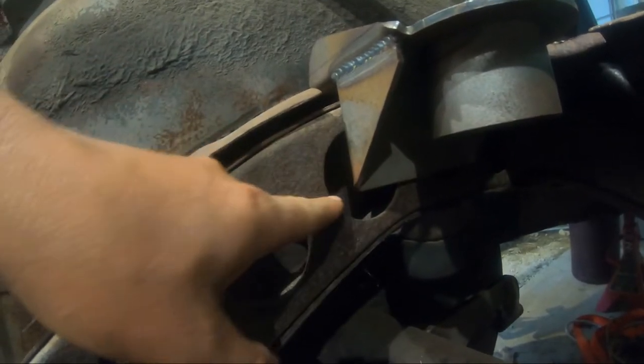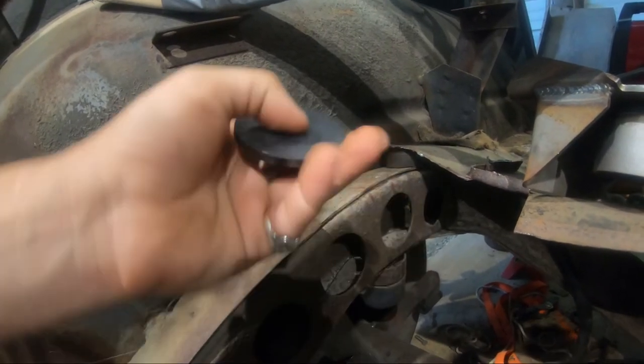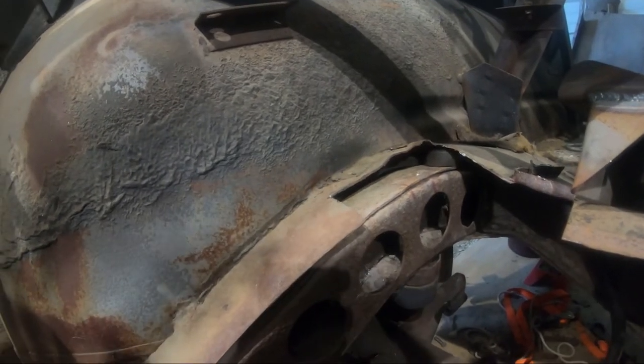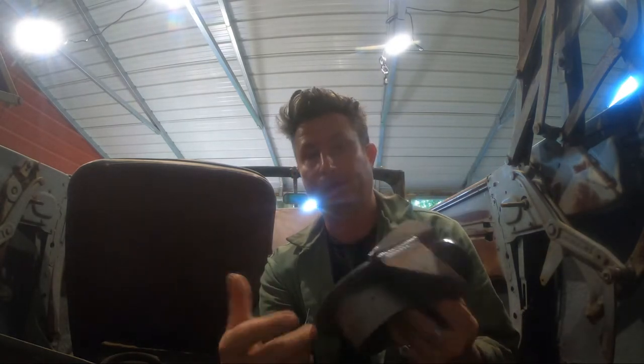In order to get this welded here we have to address this area. I dragged out the old hole saw and found these fancy discs on eBay — somebody was selling discs of every size and thickness. I was at work when I ordered these so I ordered 3/16ths, which is actually thicker than our frame rail. As you can see they fit in our hole pretty well. Step one is to weld these discs into our frame anywhere that our upper mount is going to attach, so we have extra structure and a surface to weld to.